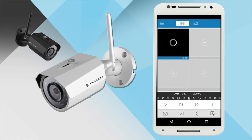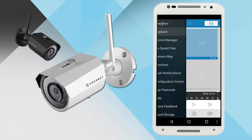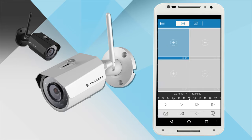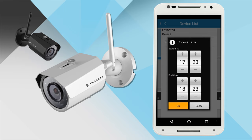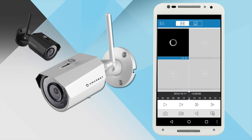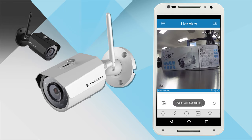If you are having connectivity issues due to Wi-Fi or your cellular network, please refresh the playback feed. If the video feed drops or loses connection, tap the menu icon again and tap Playback to access the playback feed once more. We hope this video has helped guide you on how to configure, record, and playback video on an SD card on your IPM723 and IP3M943 Wi-Fi bullet cameras.